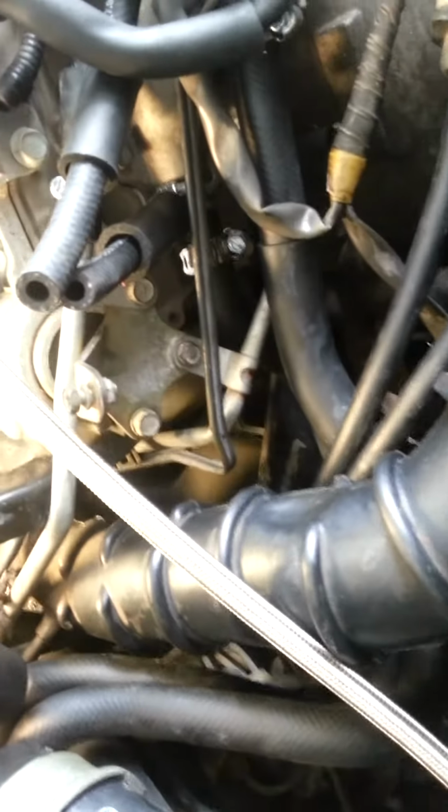All the coolant tubing has been replaced. Take your time. It's a little fiddly. You'll probably want to use some long nose pliers. Make sure you soap up the ends real good, and once you get them started, they usually feed right on. Think about where you're going to put your clamps and how you get them screwed down once they're on, which way they're oriented. Make sure you put them on in the first place. Also, try to keep all the factory protective sleeves on the hoses, and where everything was bolted up and how everything was secured.